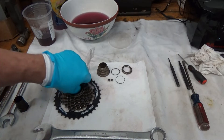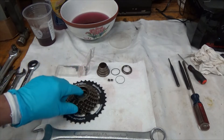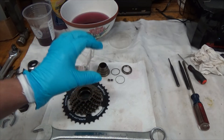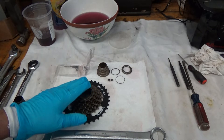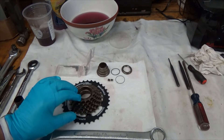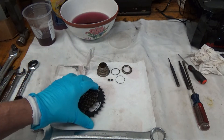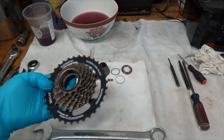It's a freewheel, and the freewheel is built into the gear set as opposed to a separate freewheel hub and a separate gear set. Freewheels are different from cassettes in that with cassettes all the gears are built up separately or in groups of two or three, whereas with a freewheel the entire unit is kind of riveted or otherwise assembled together and doesn't really come apart.